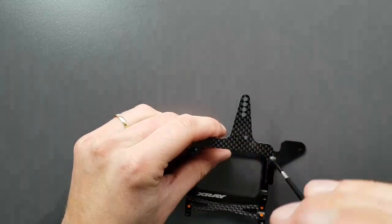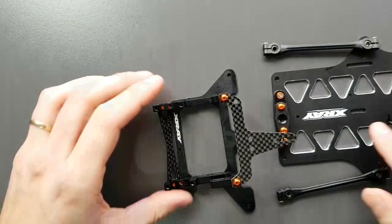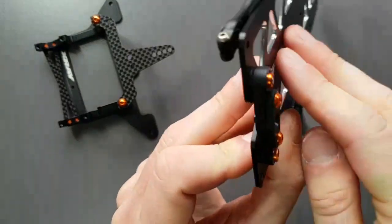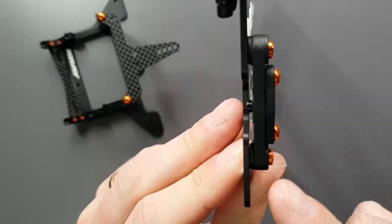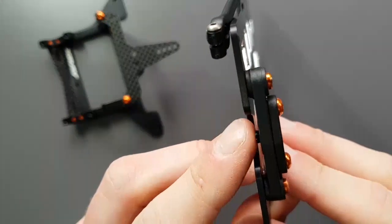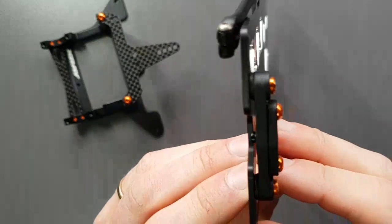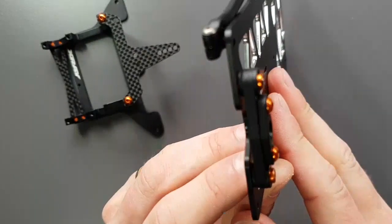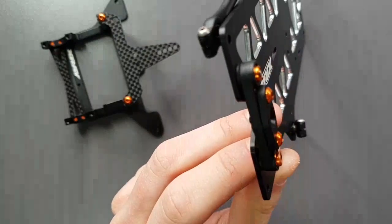That way you'll avoid any surprises during your runs - just use that tip to make your car more bulletproof. Next bit is putting it together with the chassis. I already mounted my pivot - it's just put in, I didn't tighten it up yet. These screws right here are tightened down, but they're not over-tightened. You need to make sure you don't over-tighten these, because you'll end up binding the center pivot ball. I always say it's better to have a little bit too much play than binding. A little bit of play in all directions is fine - obviously we'll try to minimize it, but a little bit too much play is always better than binding.